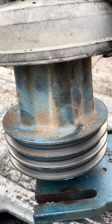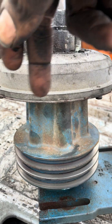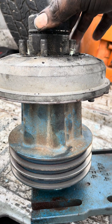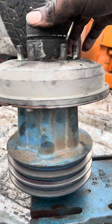So I put that on and I go to wiggle my fan clutch around. The fan is moving — and I don't mean spinning, I mean moving, like if it's on the end of this, it's moving like that. Y'all hear that? That's a shot bearing.